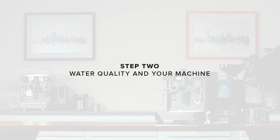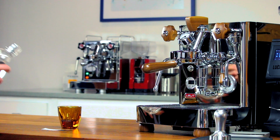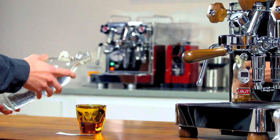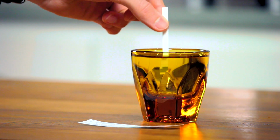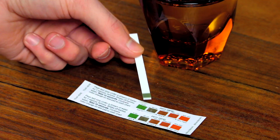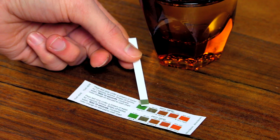Step 2. Water quality and your machine. Before introducing any water to the machine, it's important to test it to make sure it's adequately soft. Use the included water test strip to verify the softness of your water. Ideally, we're looking for a hardness around 50 parts per million. For more information on water, take a look at clivecoffee.com/water, which is also linked in the description of this video.